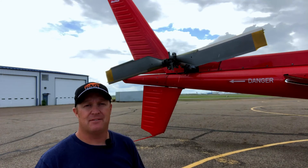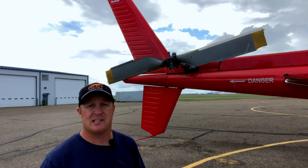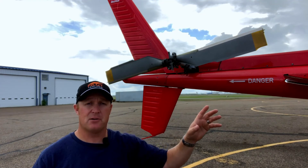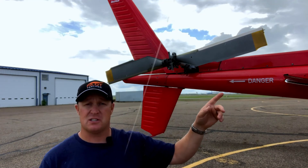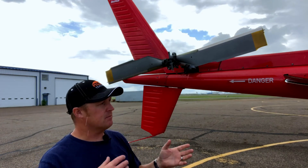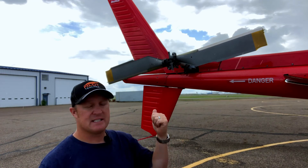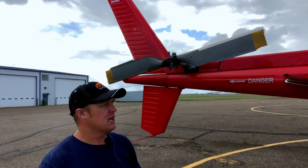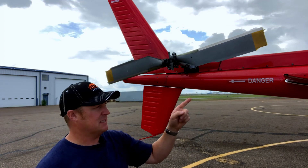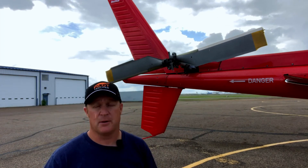Some people have the misconception that you control the tail rotor by adjusting its speed — that is incorrect. The tail rotor is mechanically linked through a driveshaft and the transmission to the main rotor. The main rotor turns at about 390 RPM and the tail rotor turns at about 2,085 RPM, so it's about a 5-to-1 ratio: for every single revolution of the main rotor the tail rotor does 5 revolutions. There's no way of adjusting the speed — it's a fixed speed linked through gears and driveshafts, so when one's turning, they're both turning.